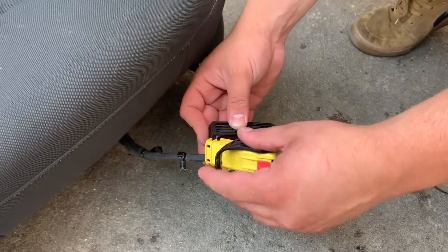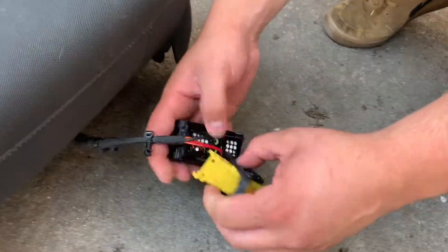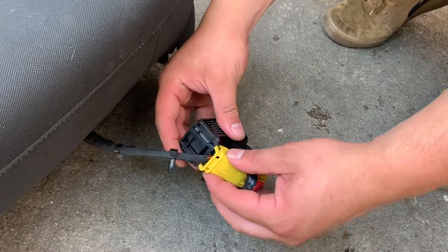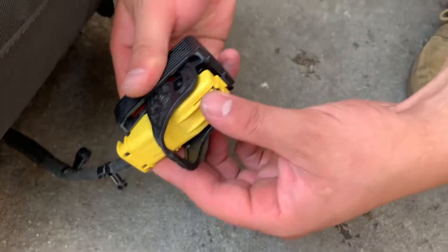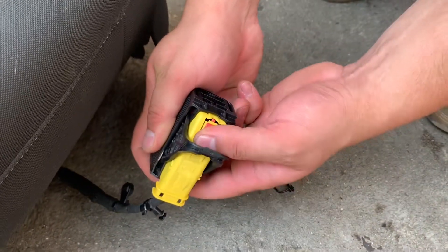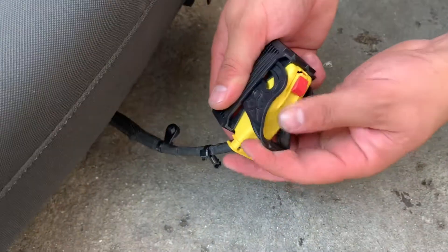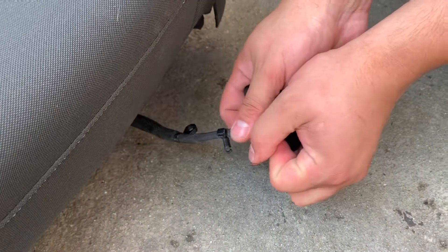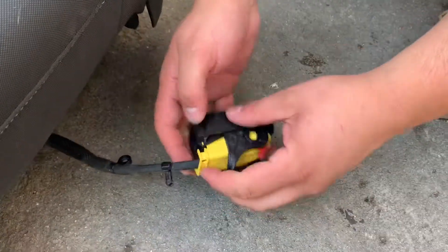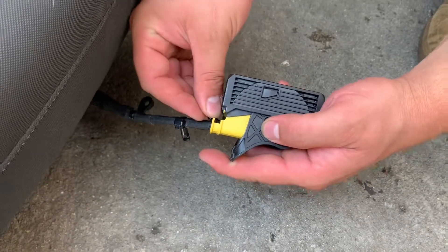The way to take these off — they only have one pin here and they clip in the back. You hook them up on both sides, make sure the hook's in the back, then just slide forward. Keep pushing and this little retainer clip goes on. This just orientates it. If you get it stuck you need to go to the inside and close them down. There are zip ties here holding it together and that's it.